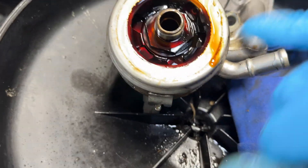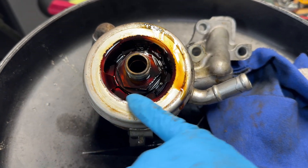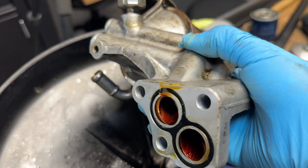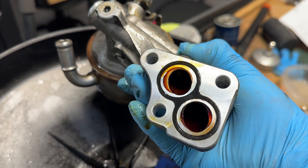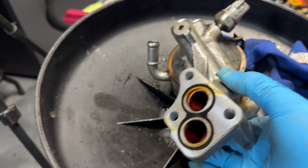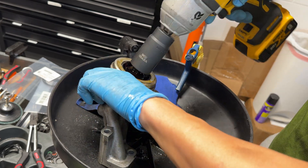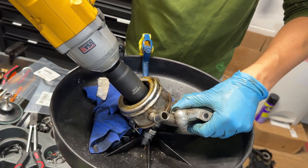The front one I showed you is right behind this nut right here, so we're gonna have to impact this thing off. Right here you can also see all the old oil buildup from poor maintenance — letting it sit too long. You can see that brown stain inside the tube; that's not normal if you use synthetic oil that you change often. If you don't have an impact wrench you'd want to shoot this off on the vehicle, but since I have an impact gun I'm gonna go ahead and shoot it off. It's a 30-millimeter right in the center — put it in there, be careful how you hold it, and just hit it a couple times with the impact.